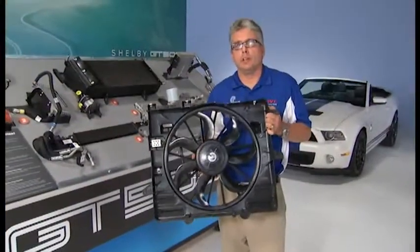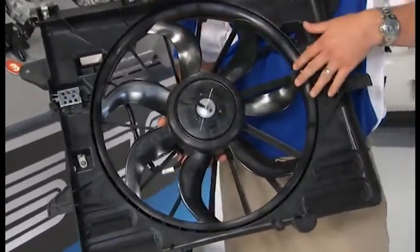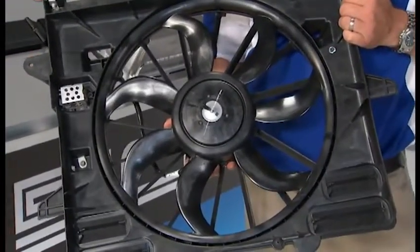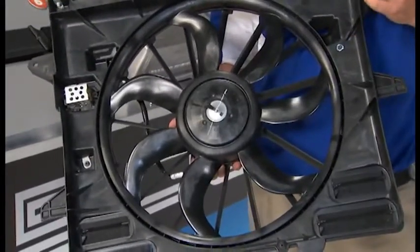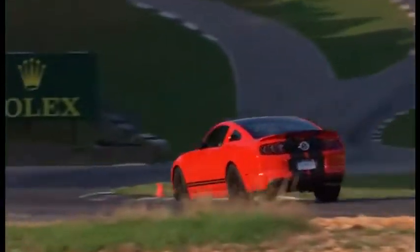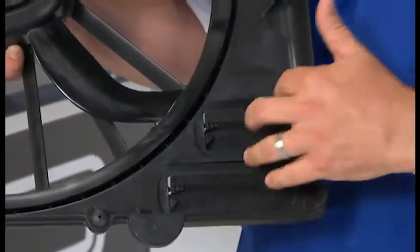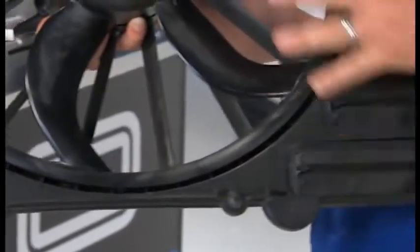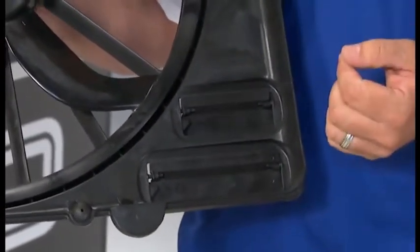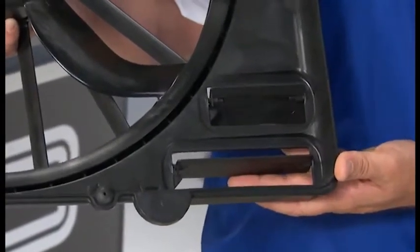Another key part of cooling this fantastic engine is airflow through the radiator and other heat exchangers. We've upgraded the cooling fan on the car — it has an extra blade for a total of seven and we've also increased the power on the electric motor that runs the fan. The fan takes care of relatively low speed cooling, but as vehicle speed increases you transition to ram air becoming the dominant influence on air going through the heat exchangers. In order to facilitate that, we've added speed flaps in the lower corners of the shroud of the fan to allow air to go through an area that would normally be blocked. At low speed when the fan is operating these draw shut so that all of the air being pulled by the fan goes through the heat exchangers. When vehicle speed increases and you start building air pressure from the ram air these flaps rotate and open up, allowing for even more airflow through the radiator.